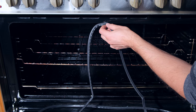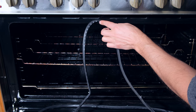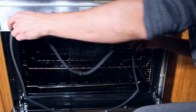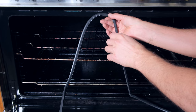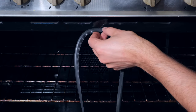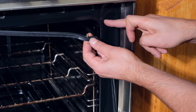Therefore on the seal I must make sure that the bottom is the section with the two metal pins sticking out. I'm starting over here at the top because there's only one hole, whereas on the bottom there's two holes. So I've aligned the seal with only the one pin on the top. Now the question is which way does this go — does it go like that or like that? So I first try one way, but after hooking it in and pulling along I can see at the corner that the orientation is wrong. That means I've got it on backwards, so I twist it and face it in the other direction, which flips the corner and now I can see the orientation is correct.